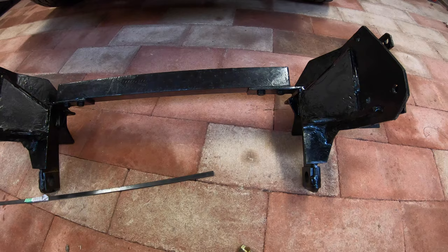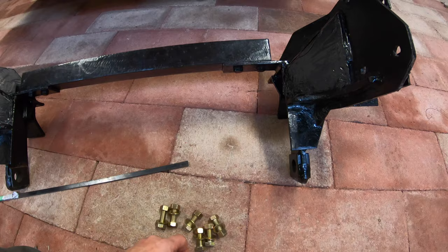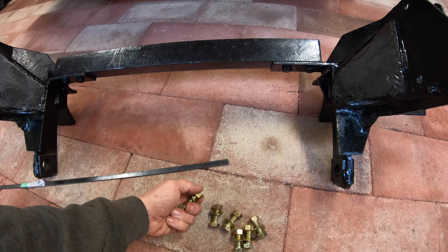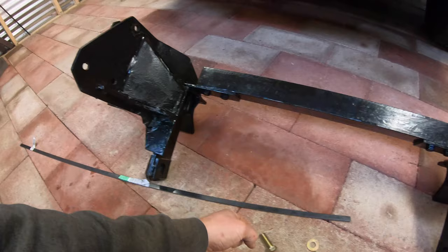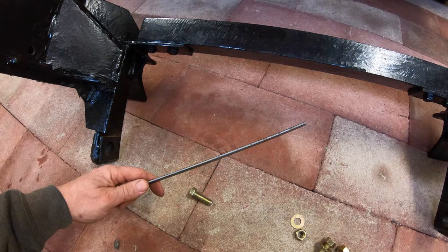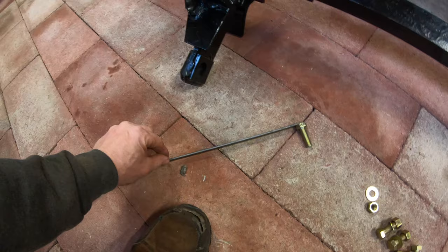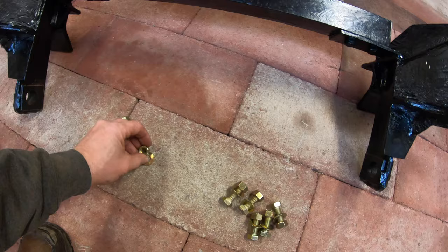The instructions and fisherplow.com show how to do this as well as the hardware involved. What it lists is basically half-inch grade eight bolts with nuts and flat washers. There are little arms connected to the bolts which allow you to grab the bolt and slide it down the end of a frame — inside the frame — and poke it through the hole. That steel piece welded on the bolt stops it from turning when you go to tighten the nut up on the other side.